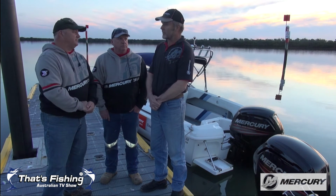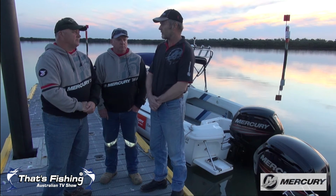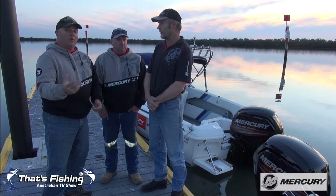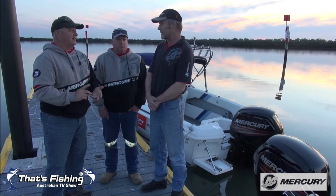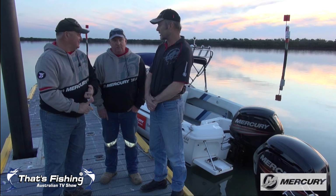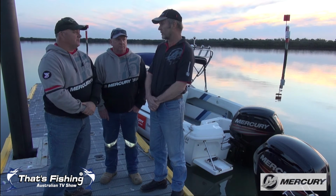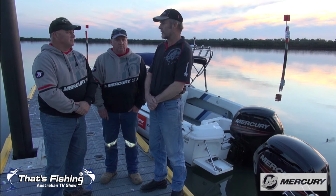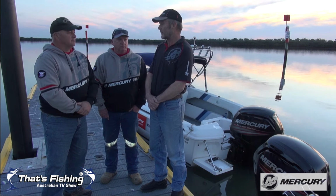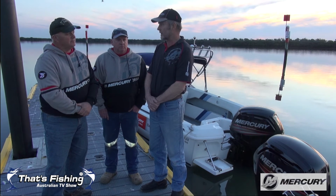Three kilos lighter. Plus, the other advantage is there's not a lot of room down the back of that boat for a second battery. We took the oil bottle out, we put a second battery in. Now no more oil. A bit more secure in knowing that he's running a winch and all the electronics, live bait tank. The charging system on these engines now is quite good. They're 38 amp and they make it at quite a low engine speed.